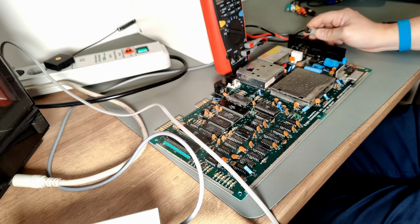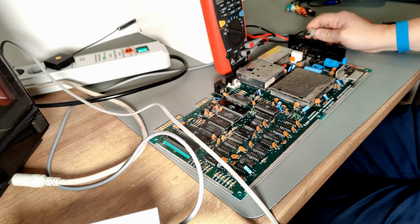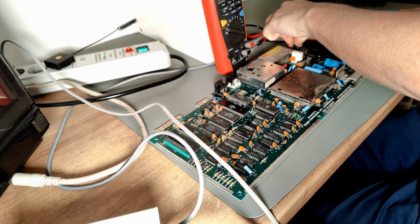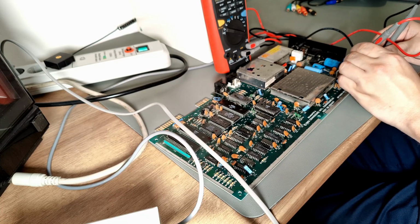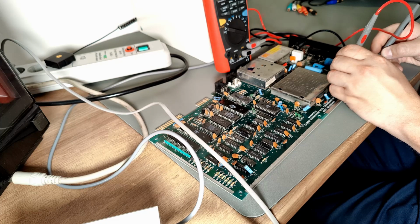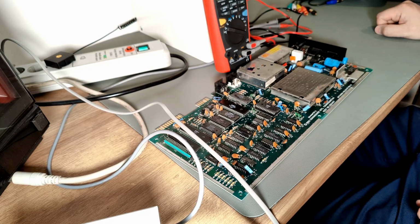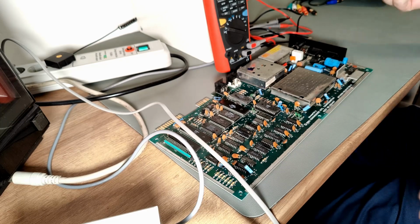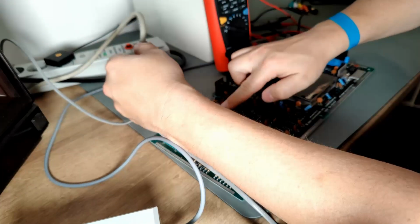I got away from the old power supplies by now because I already had and heard of a lot of broken original power supplies. Yeah, then let's measure the voltages. So here actually 5 volts should come out. It's 5.0 volts, that's fine. And here should be 12 volts. It's 12.12 volts. Yeah, perfect. So it doesn't look that bad at all. Next, we'll see if anything gets warm.